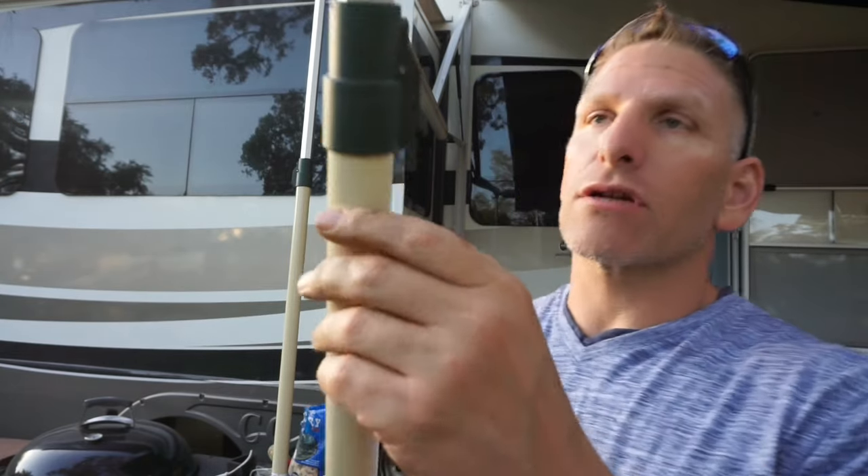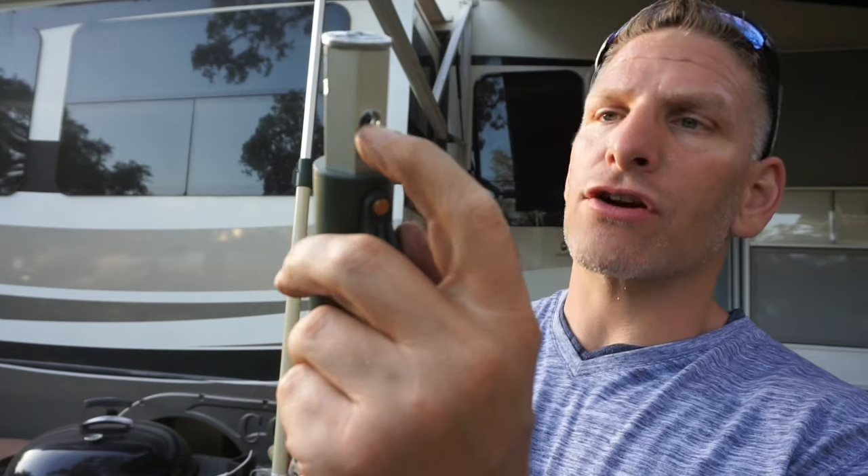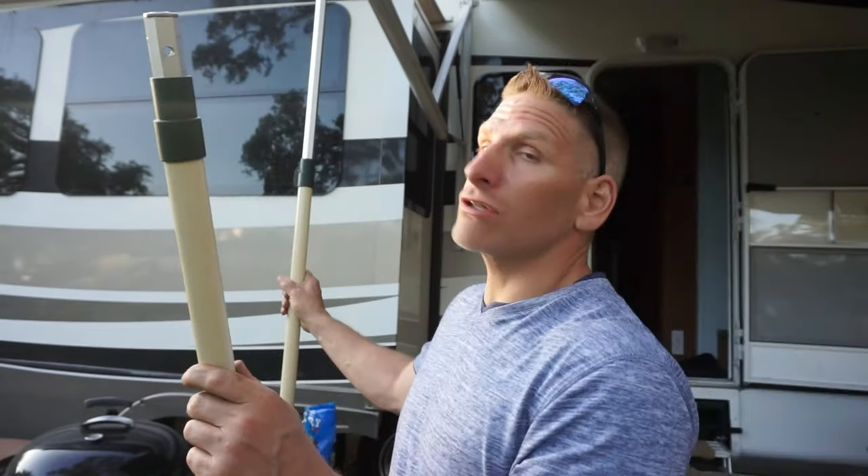As you can see, I already have one awning pole up there and it's bolted in. These particular ones I bought at Home Depot — you can see where I cut the end off. They had screws in here to hold that end in; I tried to pry it out but it wouldn't come out, so I just cut it off. What I did is I took those screw holes and used them as guide holes for the bolts that are going to hold the pole up to the awning — that's the permanent part of the install. So I drilled those holes out and now we can hang it up there and it'll be secured to the awning.